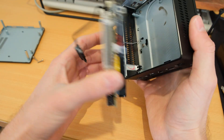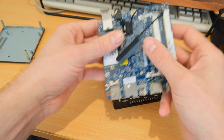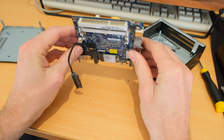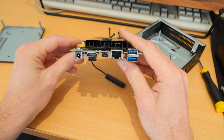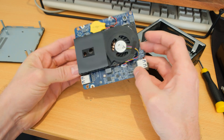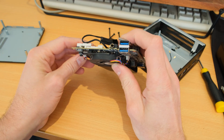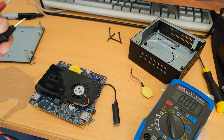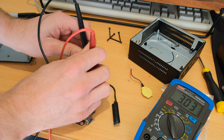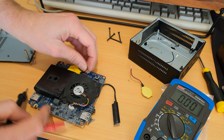It's not too hard to get the motherboard out of the chassis. I usually mark the antennas with a black dot depending on which wire was connected where — they are color coded on the card, but it looks like this was in reverse order. On the back we have the CMOS battery and the heatsink. It's a very small form factor packed motherboard. There are a lot of USB 3 ports which makes installing media quite fast. I'm checking the voltage on the CMOS battery and it seems to be good still — I have a spare CR2032 but thankfully we don't need that.